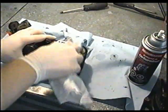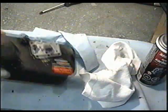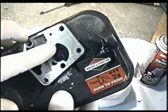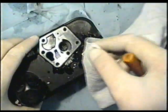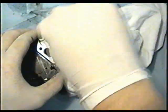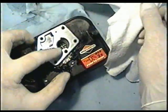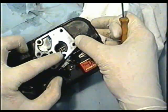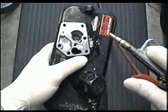The carb cleaner has been sitting for a while. I'm just going to clean the surrounding part where the carb goes. I'm just going to tap the fuel tank upside down - some of the dirt will come out by itself. As you can see there's a bit of film of dirt on here, so I'm going to spray some more cleaner in there. Next, you can grab a rag and a small screwdriver, insert it down the hole and then work it in there until all the dirt comes out. You can always use your air compressor to blow out any dirt that's left in there. Just make sure you've got safety glasses on.